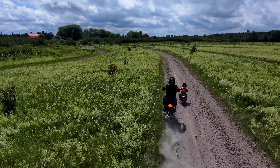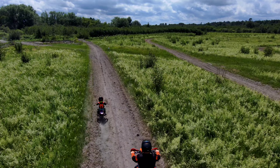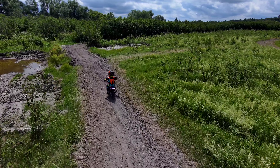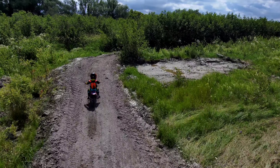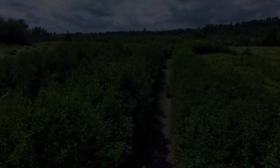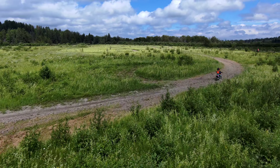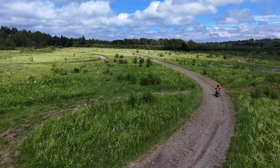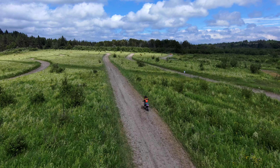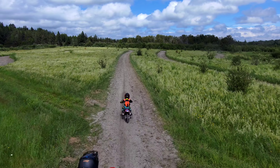Let's talk about chassis and build quality. It's a nice tubular steel frame. The frame is a bit shorter than the TTR and KTM and it's got a little bit less rake, so it does perform well at low speed for handling. At high speed it is a bit twitchy — the TTR and KTM both have a bit more rake and handle better at high speed. As for placement of controls, both brake levers are on the handlebars — front and rear. The levers themselves are designed smaller and thinner, they're closer to the handlebars, and they're sized accordingly for kids, so I really like that. Case can properly reach the brakes, which is super important — some kids' bikes have big adult-sized levers and that just never made sense to me.